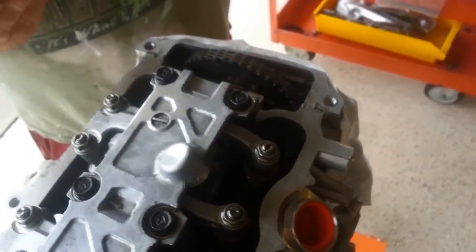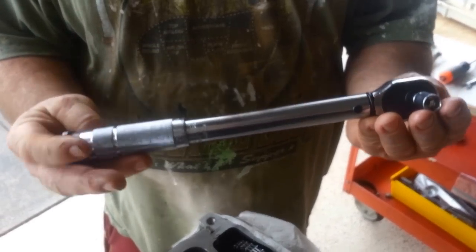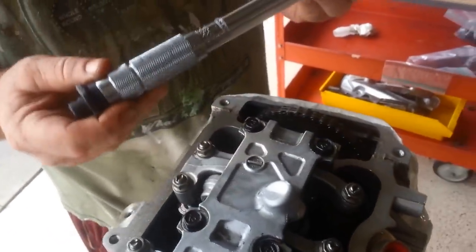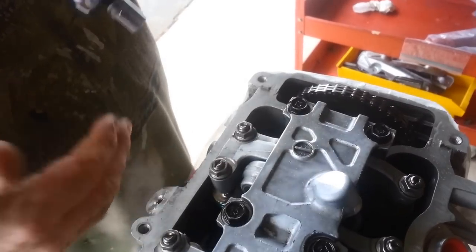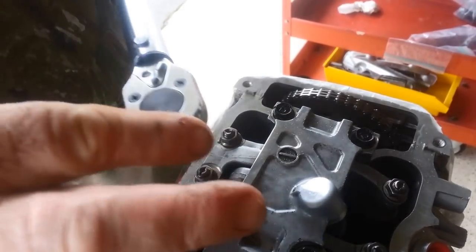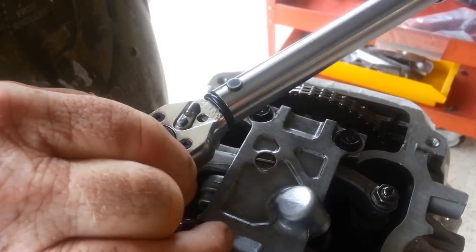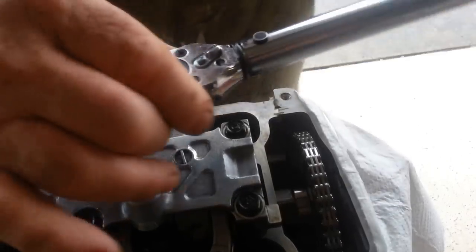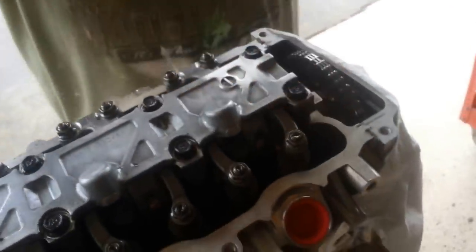The next step is to get an inch-pounds torque wrench with a quarter-inch drive. Set it to the required 120 inch pounds — not foot-pounds. Go over to the intake side first, put the torque wrench on and rotate to tighten until it clicks. Always go in the rotation of tightening — don't put the wrench on, go backwards, and then go forward to tighten. Always make your rotation in the same direction so you're not loosening and then re-tightening, because then you could upset your adjustment. Then go over to the exhaust side with the same thing until the wrench clicks.